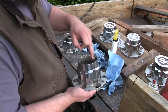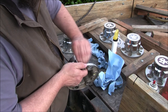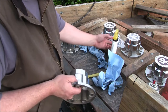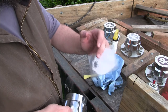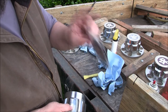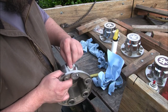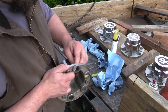I've already done all the closed caps — these are the two open ones. I've got a set of these on the truck already but I didn't pull them off, so I thought I'd just clean these up. I misspoke in an earlier video — I thought these, which are from LMC, part number 36-8215, would also fit on the front hubs, but they do not. They're too big, and I don't think they make reproductions for that. Which is fine — I'll probably be stepping up to a manual hub anyway.